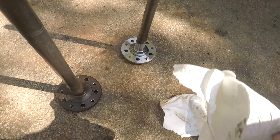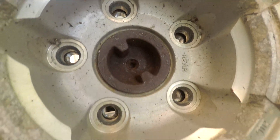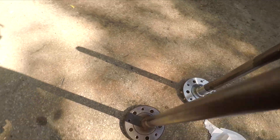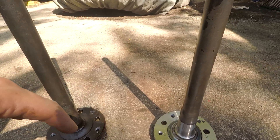That is the stock Explorer size, 70.3 I believe — I didn't take calipers to it or anything, I'm just going off what the internet said. I'm not even gonna worry about it because it fits the rims. And if we check out the bolt pattern — it was done on a CNC, so as long as my numbers are right, the bolt pattern should be right. These should fit my rims perfectly.